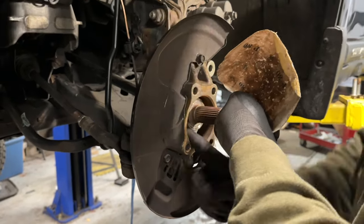That should be good enough. Go ahead and grab our brake caliper assembly and try to feed it onto the rotor. Once we have our brake caliper assembly on the rotor, we're going to grab our two 17mm bolts and fish them through — make sure you always thread them by hand first. Once we have the 17mm bolts secured by hand, we're going to adjust our torque wrench to 88.5 foot-pounds and torque them down.